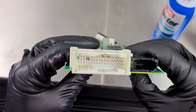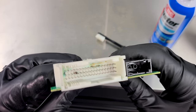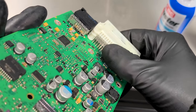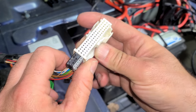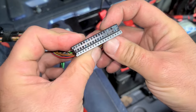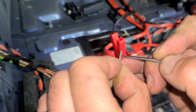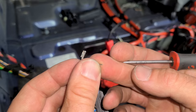The big problem with this module is the pins. This thing was potentially soaked in water for years - and there's a pin just straight up missing, corroded away to nothing. Part of that pin is stuck inside the connector. Pushing it out from the bottom - there's our broken-off pin, the very bottom just corroded away. Parts have been ordered to fix that control unit and replace the pin for not a lot of money. For now, let's tackle the battery message on the dash and why this engine doesn't run well.